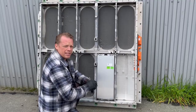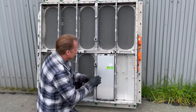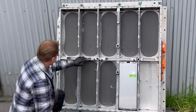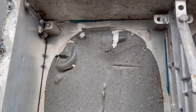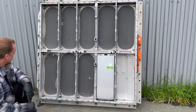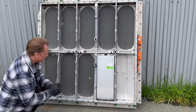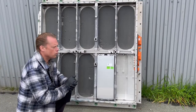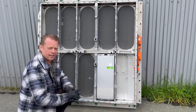To be honest, I have not seen one car out there that had problems with overheating on their batteries, so this seems to be just fine. There is no need to go inside of the battery and have the coolant inside between the cells — okay, you would have much better cooling or heating, but there would also be a risk to have that inside of the module. Maybe you will have some leak or stuff like that, and that's not good at all. And as you can see, we have some damage to this battery box but still we don't have any coolant fluid inside it — water and electricity don't mix so well, so that's a good thing.